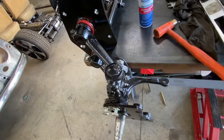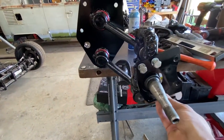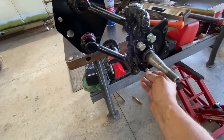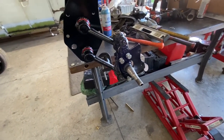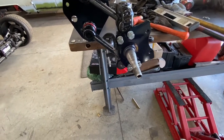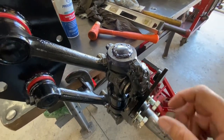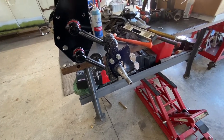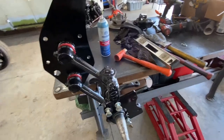Here's how easy this brake setup mounts. That's the bracket — four bolts, just like you'd mount the drums. The kit I purchased from Dove Fab came with everything you need to mount it. You tighten down those four bolts and you're set. Then you put your hub on, tie it down, get it all set up, and then put the caliper.